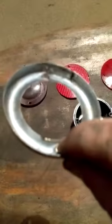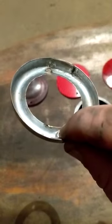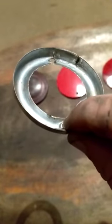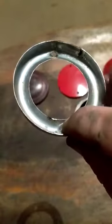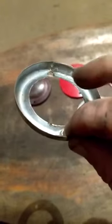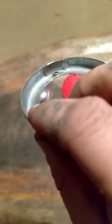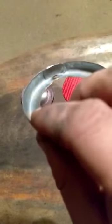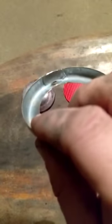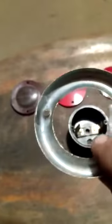What I've had to do with the cracks is make some very small little repair patches. There we go — we can see the repair patch there, and the same on the other side. To repair this and give strength where it's cracked, I've used some very thin stainless steel plate, shaped it to fit, and glued it in using a glue similar to super glue but more of an industrial super glue. It's really strengthened up the ring.